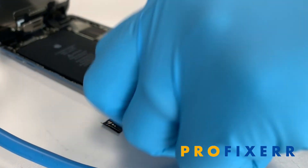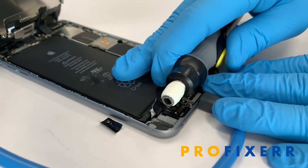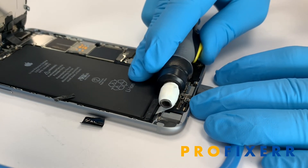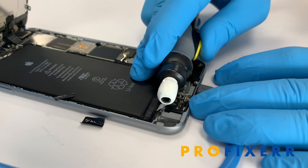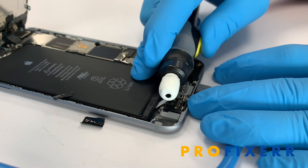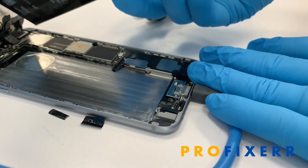And so now there's the last one here. You will need to use a razor blade to cut this off of the screwdriver. You don't want it to get too big because then it makes it rotate at a faster pace, and that could actually break the tab from pulling it too fast. But just like that, we got all three tabs out very easily and now the battery is completely loose.